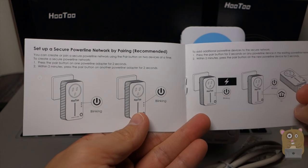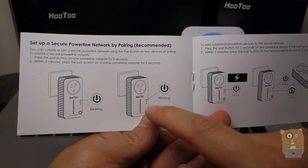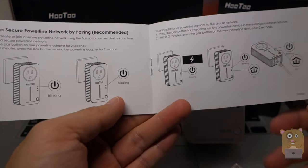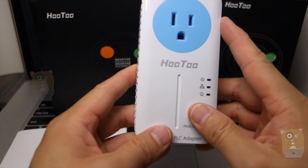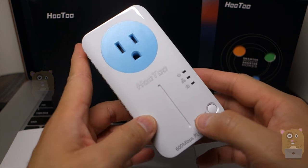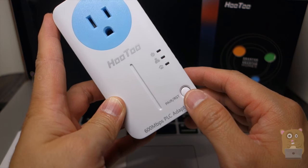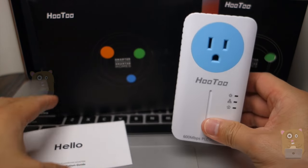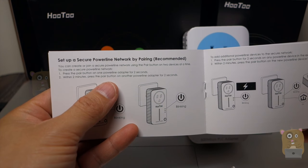Here's the pairing section — this part is actually incorrect. It says plug it into the wall, make sure it's powered up, then press the pair button for two seconds. Well, what I found out was that does not work. The correct way is: plug this into the wall, plug the network cable in, then on the other end plug it into either the router or your computer. Once the top two LEDs are illuminated, press and hold the pair button for two seconds on both devices — press it here for two seconds, go to the other device, press it there for two seconds, then the link will be established. The instructions missed the part about plugging in the network cable.